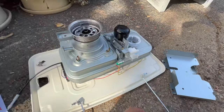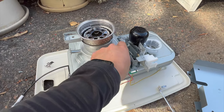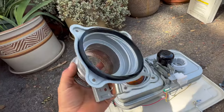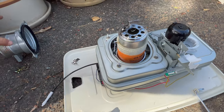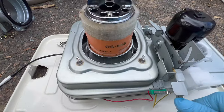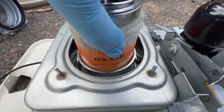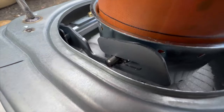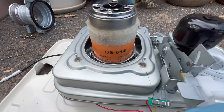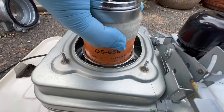After removing the wind covers, we're going to remove these four wing nuts to take off the wick holder assembly — I've already loosened them up. When you remove this, there's a gasket underneath; if it doesn't come off with it, you'll have to remove that separately. Now that the wick is exposed, the way to remove it is by pushing it down and up while at the same time turning it, removing these pins by turning clockwise. You'll eventually feel it snap out of place.